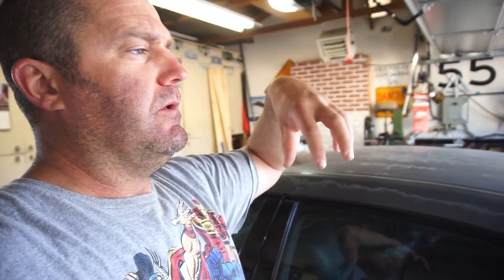So, I posted a video yesterday when I was installing these. I put a shop vac, vacuum cleaner, whatever, on the fill port. Took the fill cap off, put a vacuum there. My wife was holding the vacuum over it. And then pulled the drain plug, and didn't drip a single drop of oil. I posted a video on Instagram, and some people don't believe me that it worked, but it did.